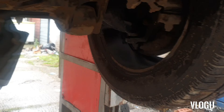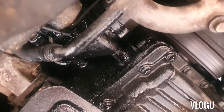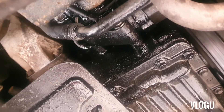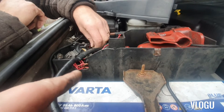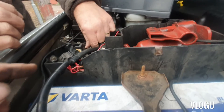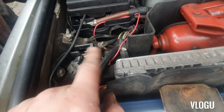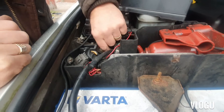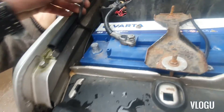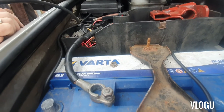On the handbrake issue, we've gone underneath and the earth looks okay to be honest — it's got some oil on it but it looks okay. It looks like in the past somebody has earthed this to the earth strip that's there, which is earthed to the body. So obviously there have been earth problems before. When we took these off to do some welding on the car, we saw this little dodgy strap here — it had been connected to the earth and it had snapped off.